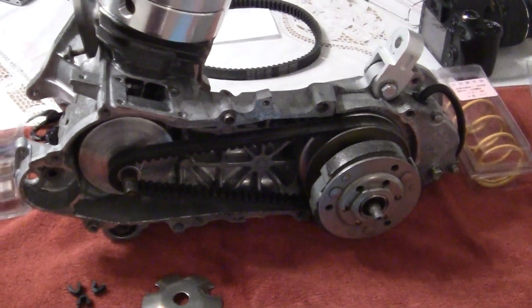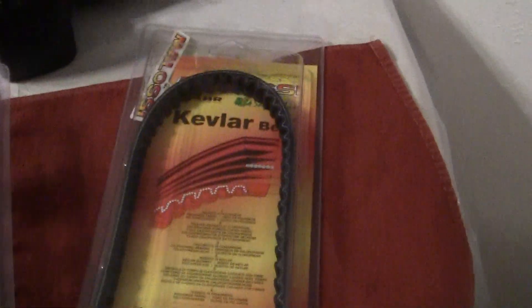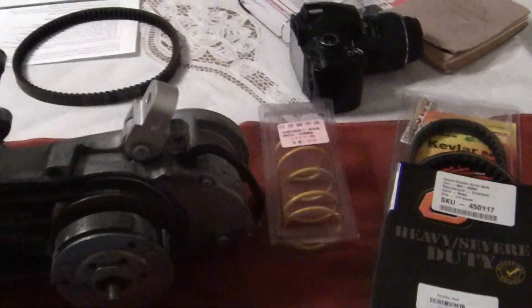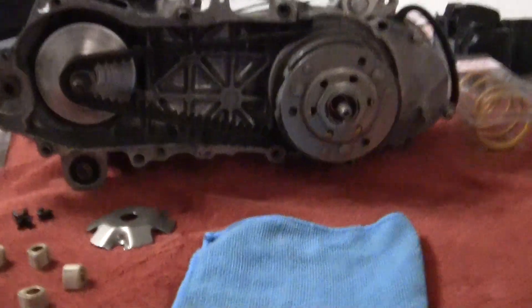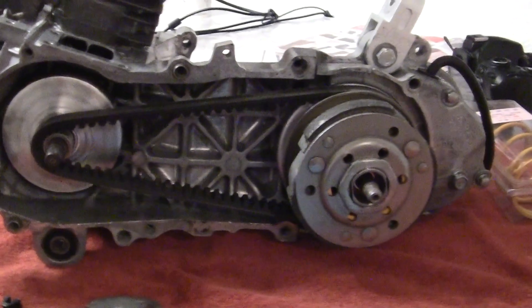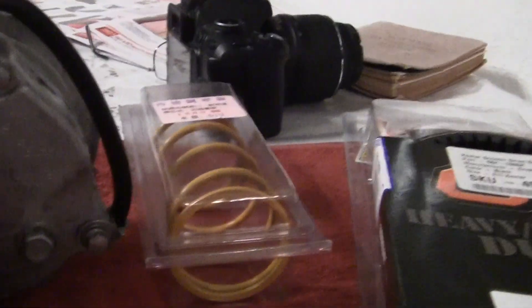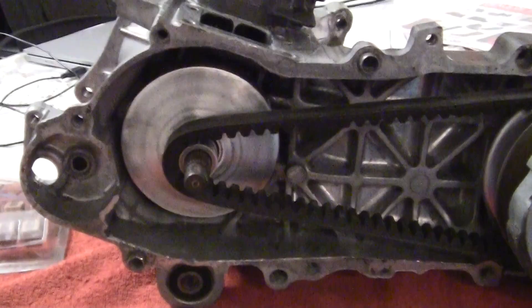So those are the three types of belts you can get: stock, ordinary heavy duty Kevlar, or the Malossi, which I haven't tried yet, but I imagine it's really good because everything Malossi sells is really good for these engines. Next video, we're going to go over how we use a 1500 stall on the back, and how to adjust the front — which is done not with the spring, but with the variator weights.